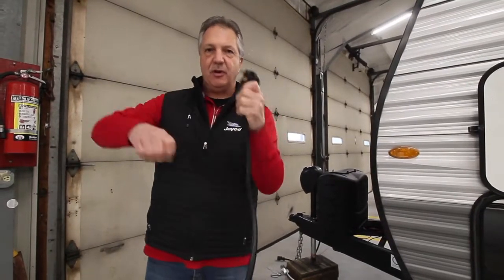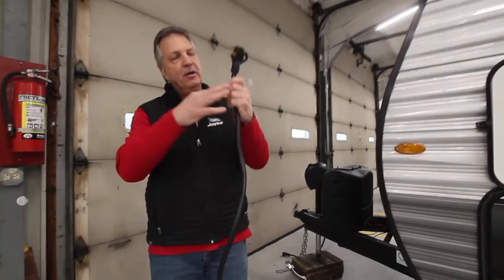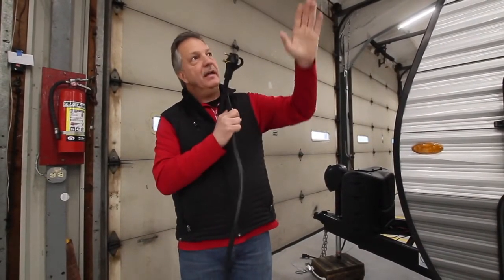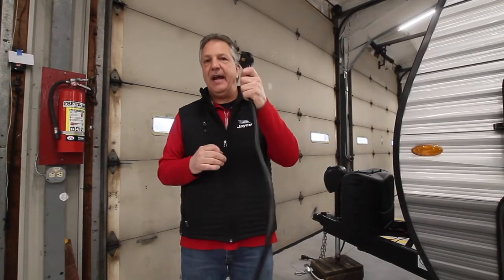The reason why the plugs are so heavy duty on an RV is because the entire RV runs off of one large wire, meaning the air conditioner, which draws the most current, probably second most is the microwave, and then you've got outlets if you have a coffee pot on or something like that. You may need 30 amp. 15, it might pop the circuit breaker at your house.